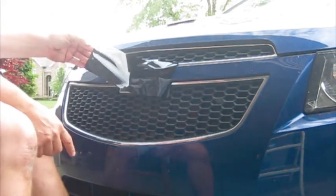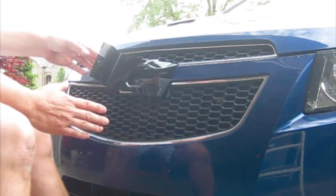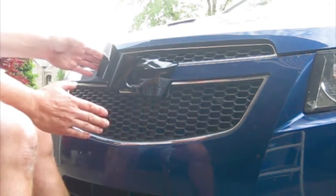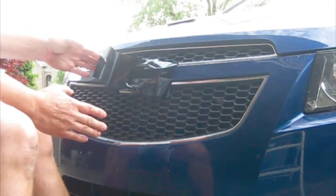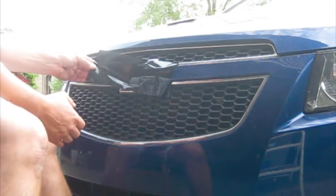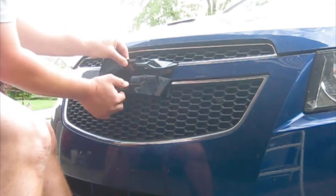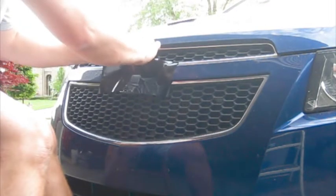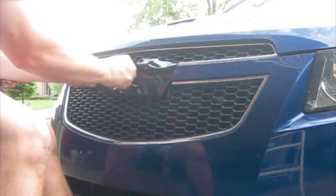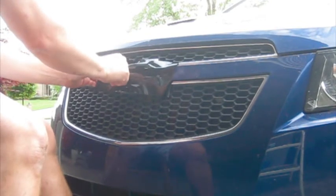On the left side, sometimes depending on the car — this is a Chevy Cruze which the emblem appears to be pretty flat, which should not be a problem. But on a Chevy Camaro the emblem is slightly curved, which causes some wrinkling in the vinyl when you go to apply it. In the case of a Camaro you would want to stretch the vinyl kind of up and down and side to side to get all the air bubbles and creases out from behind the vinyl.